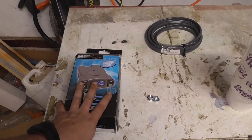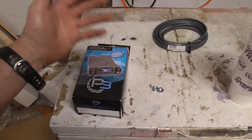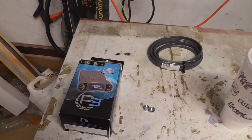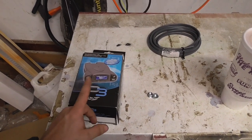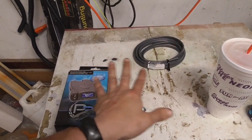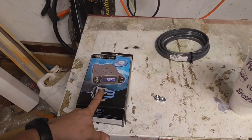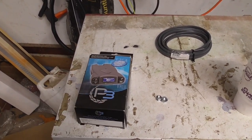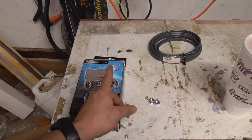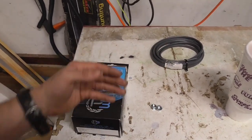This is a proportional brake controller. There are time delay and proportional brake controllers, and then there's the OEM which are integrated into the computers. The time delays are usually the cheaper controllers. The way they work is once you press the brake, it sends a signal to the controller, and then on a time delay it slowly ramps up the braking power until you get to max gain. The proportional brake controllers like this one basically have an inertia sensor in it. If you get on the brakes slow, it will slowly apply brakes and might not even get to your full gain setting.